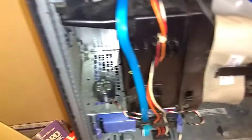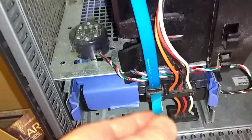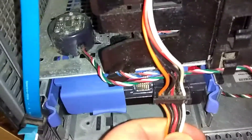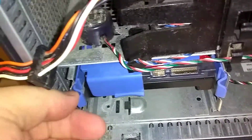Down here is your hard drive, at the bottom and the front — it's going to be this right here. It's got these plastic rails on here. First you're going to remove these cords. Pull the wires loose. Yours might look a little different — I think I exchanged some parts and made some upgrades, so I don't remember if I changed the wires out since the factory.